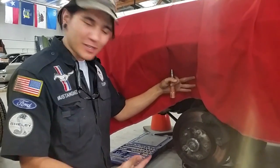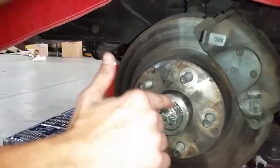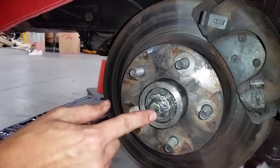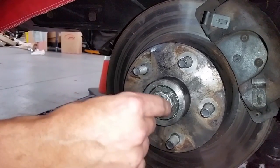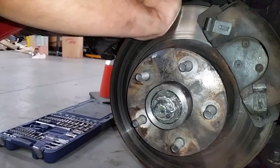Back here with your 1970 Mustang, and as you can see we're back at the front end. On the wheel bearings, I have freshly greased them — this is just traces of my greasy hands from reinstalling them. We properly set the preload onto your bearings and cotter pinned it, and that's secure.